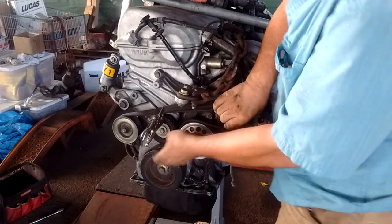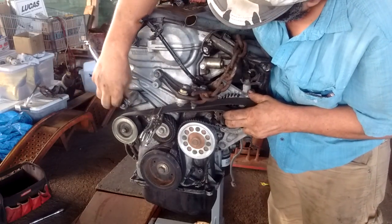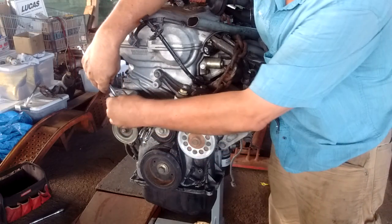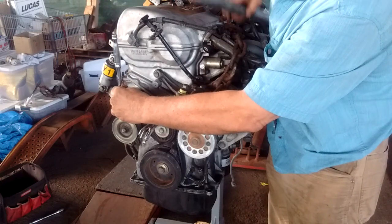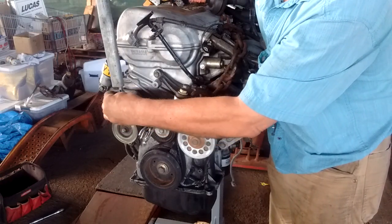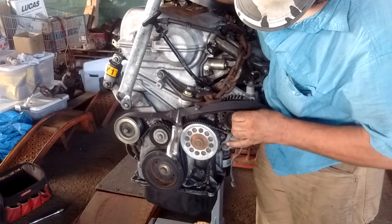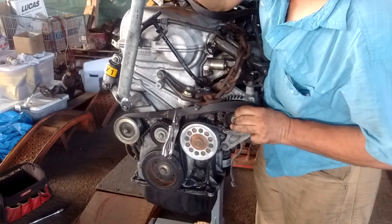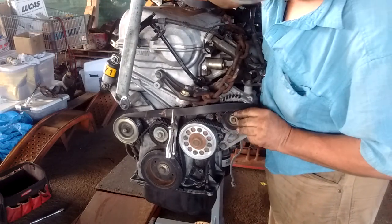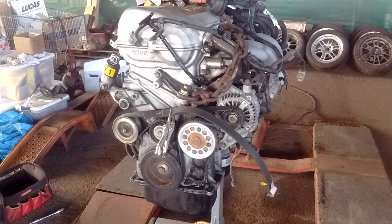So it's set about how you would want it to go. I take off my wrench and use a little extension pipe for leverage. There we go — now I'm going to move the tensioner. The dipstick is in the way, but we work around it. Now we've got the belt with tension applied at the length that we want.